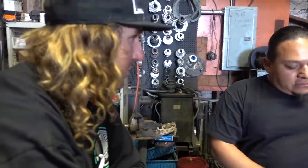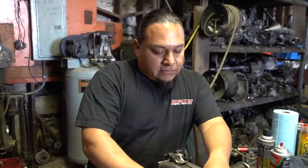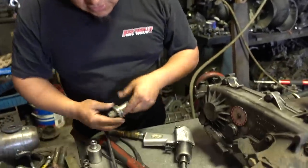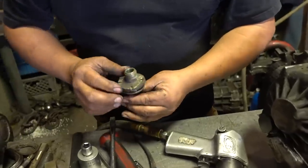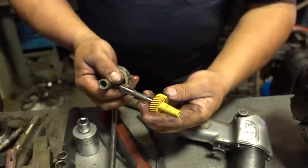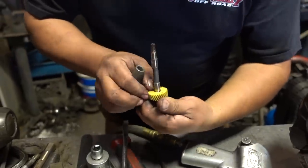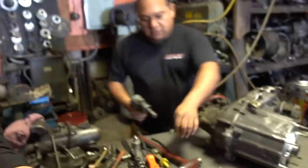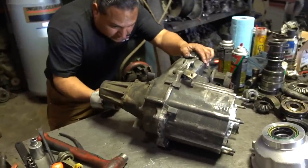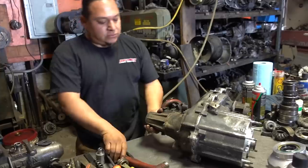Now, you can clock that to adjust your Speedo? Yeah, so this Speedo is a clockable type. You see it's not centered, it's eccentric. So you could clock it, and you could change the Speedo gear here, depending on the size of tires that you have. This is a 30 tooth. 32 would be good. 36, that's probably like...